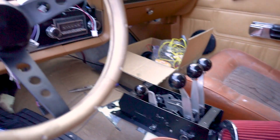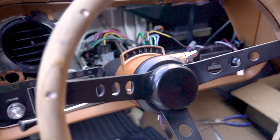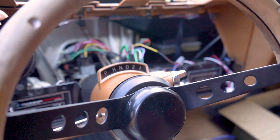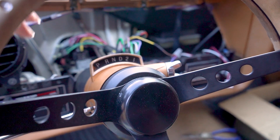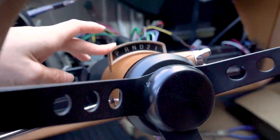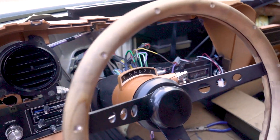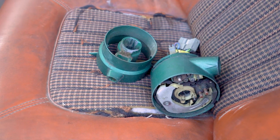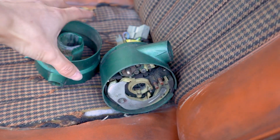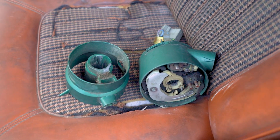Now we have to modify this steering column to make it look like this car was a factory floor shifter. I already took out the shift lever — super easy to pull those out, it's literally just a roll pin you tap out and the whole lever comes out. But there are a couple other things you have to do: you have to pull off this indicator and fill in those holes. I'm NOT going to chop up the factory one that came on this car because I love the originality of it, so I went to the junkyard and pulled this off a '79 Ranchero — pretty much the exact same car as this LTD. We're going to cut this up, fill in these holes, and make it look like this is a factory floor shifter car.